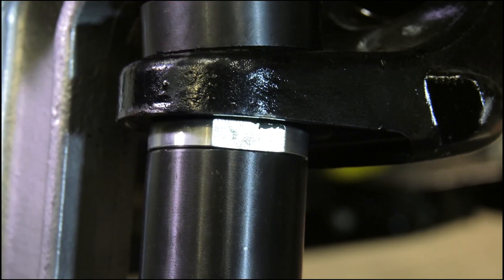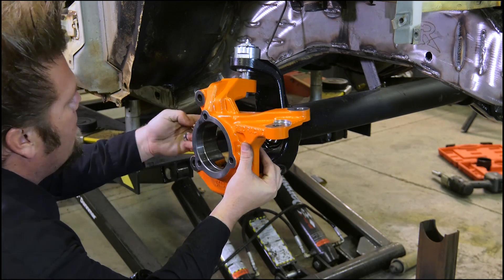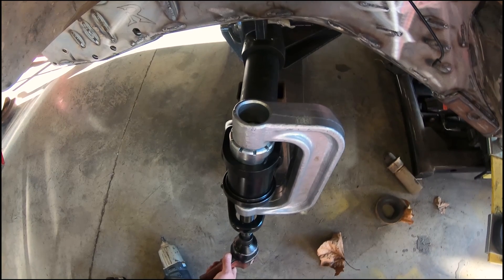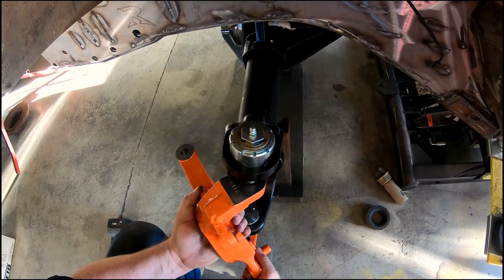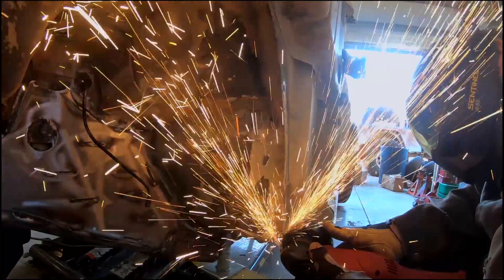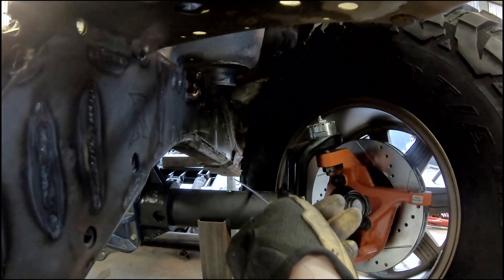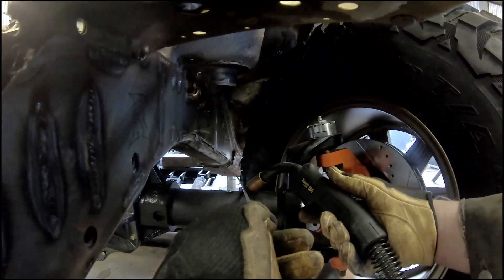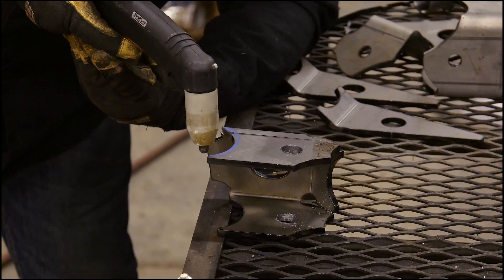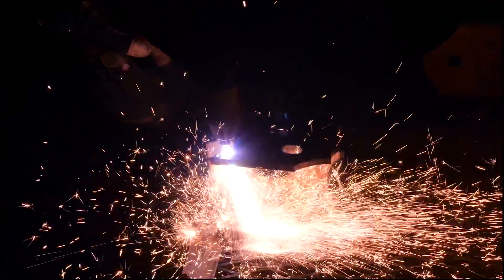When you build a custom suspension on the front of a rig, you can't just drop the axle in and start welding brackets on, because there's a lot of things you have to take into account. You've got to plan for where the tires are going to hit when it's turned. So you need to assemble everything from that inner C all the way out to the wheel and tire — putting in the ball joints, the knuckles, even the brake rotor, because it does make a difference. Then you bolt the tire in place and start to turn it, figure out any clearance issues, as well as figure out where your lower links are going to fit. If you do it right, you should have no tire contact on the link when it's turned all the way.